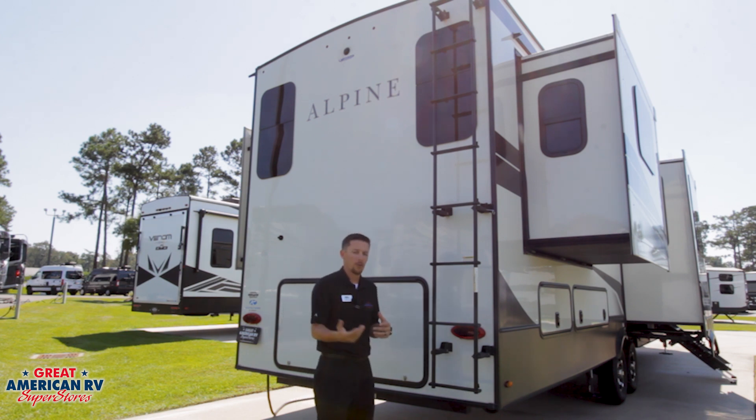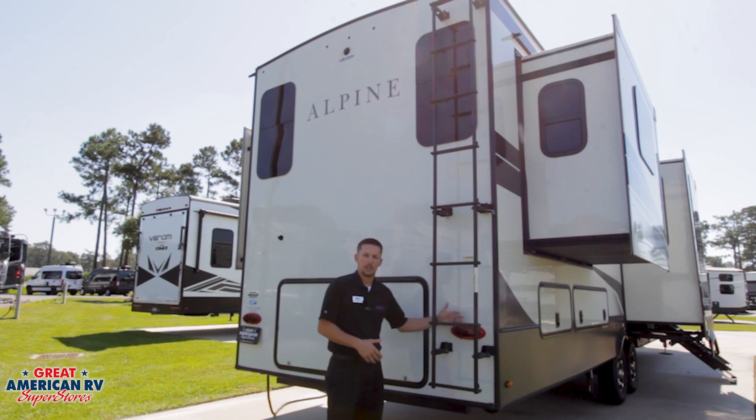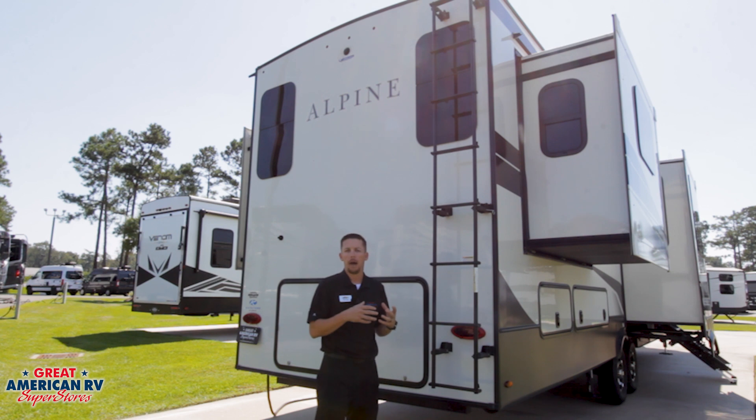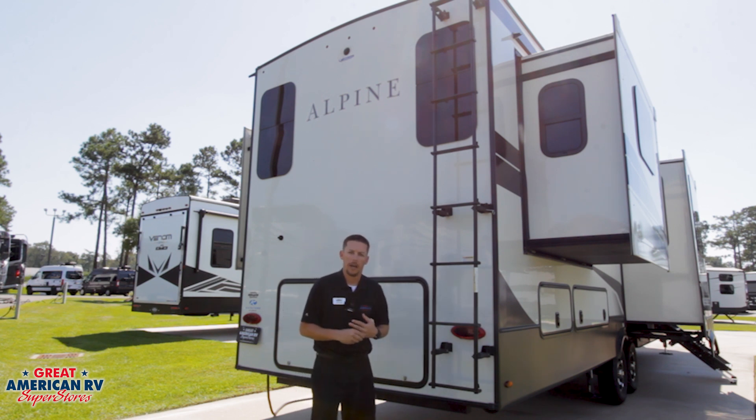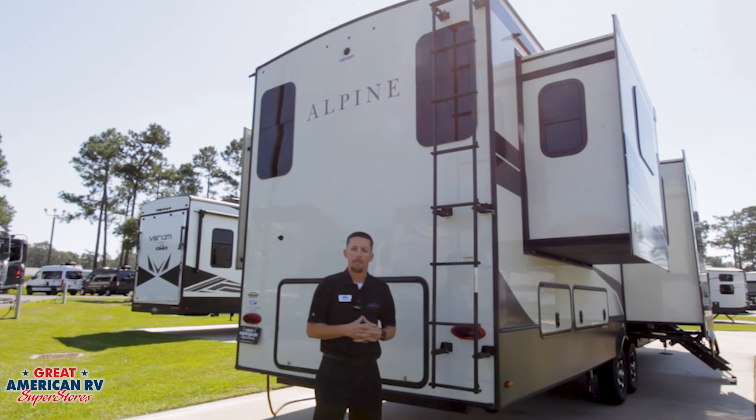In the event that that fuse isn't blown and you're still having issues with some of these lights, you can check the 12 volts at the light or the connection box where that seven-way goes into it. There may be a loose wire there, but mainly all of that power is going to come from the vehicle itself.